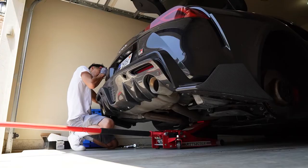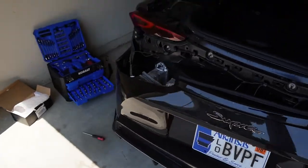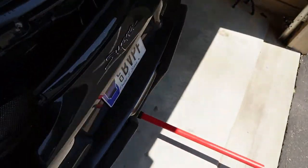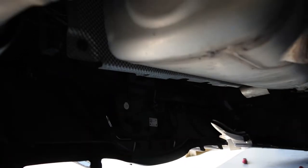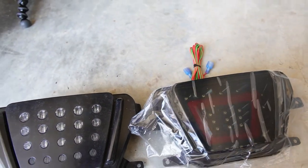Actually there's one more place — there's a screw that sticks right up there too. Now I have the bumper completely disconnected. I was thinking about disconnecting all the wires but I think I have enough room since I'm a small person — I can just fit through underneath. That gives me enough clearance to unbolt the brake light. It's just four 8mm bolts and then it comes right out. Finally got the old light out!